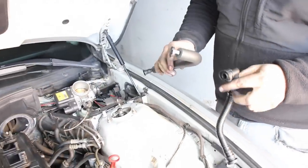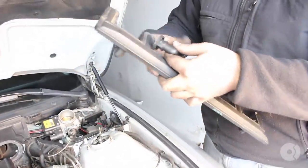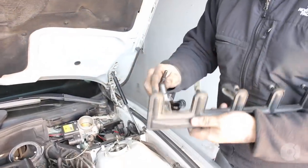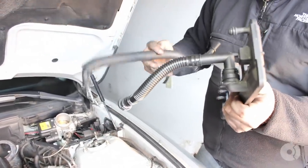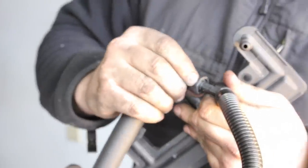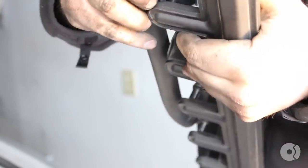The first thing I'm going to do is reassemble the pipes coming up to the intake plenum spreader. The orientation of the spreader is like this. This hose will attach here — you're going to wait for that click, which means it's secured. Then you have this hose here that kind of just slides into place; you're not going to really hear a click, but you'll know it's secured because it seats fully. And then this end here connects to the second connector — push that in until it seats all the way. That's the hose setup for the spreader.